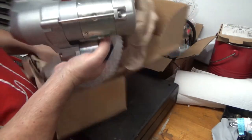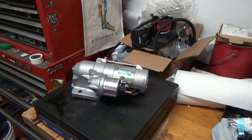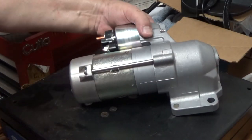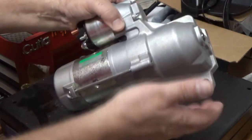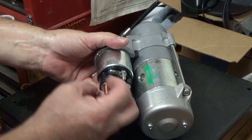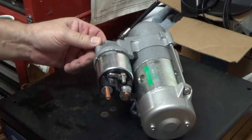By the time I did all the math, the only cheaper way to go was Bosch rebuilt, which seemed acceptable to me but I didn't end up doing it. This thing is weighing in at 10.3 pounds. Replacing a starter — the procedure is pretty much the same for every vehicle ever made: there are two or three bolts holding it on.